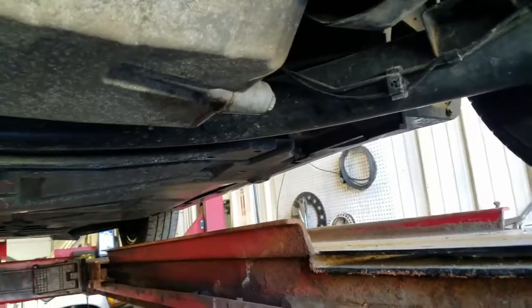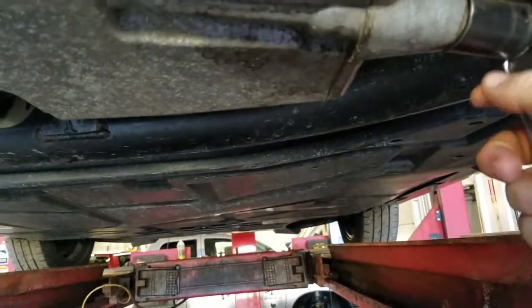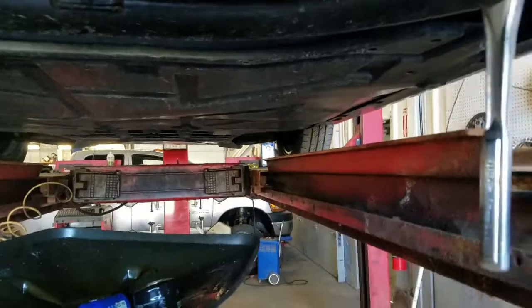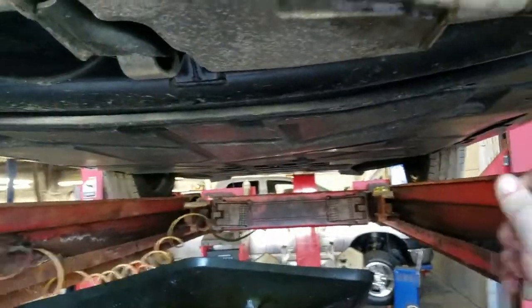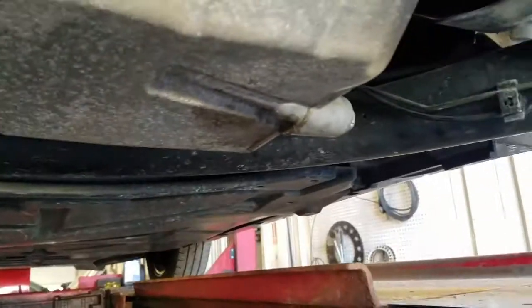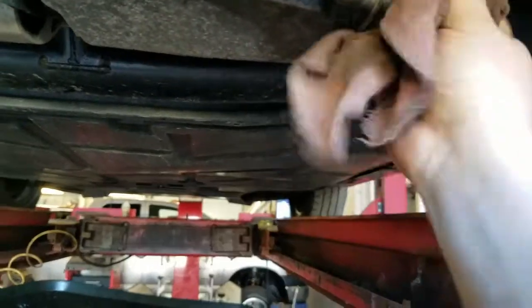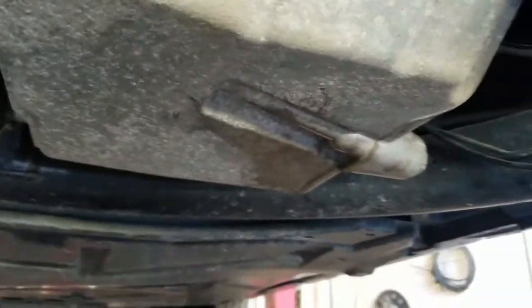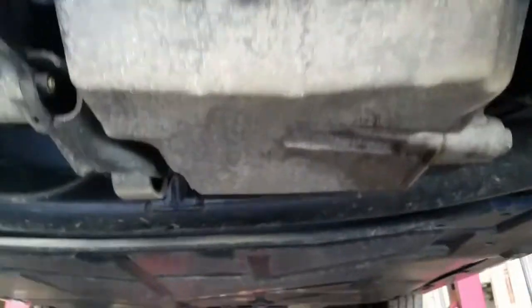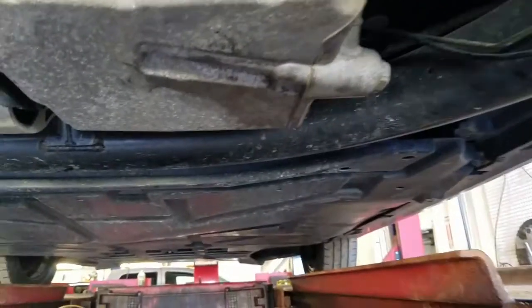New filter's in place — haven't torqued it down yet. According to the service manual it's supposed to be torqued to 48 foot-pounds. I'm not using a torque wrench, just a standard ratchet, so I'm going to the generic measurement: good and tight. That should mean I won't have as much trouble removing it next time. I sprayed the area down with brake cleaner to clean up any oil residue. The importance of doing this is so that if you see any oil later, you know you have a leak — you didn't just forget to clean it.